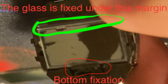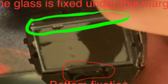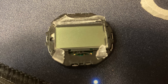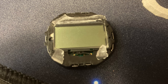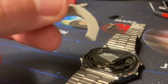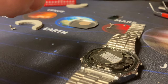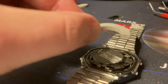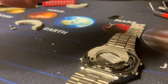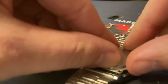The new glass has very low quality - it is thicker and does not fit in. I had to trim the top margin with a cutter and stick the glass a little with nano tape. I did this thinking that the module would be pressed and the glass would stay fixed in position. Clearly I was wrong. So I found this sponge - it's a plastic piece - I will just try to put it here on top, roughly in the middle. And now I will try to seal everything.